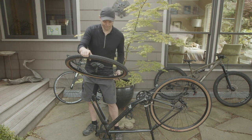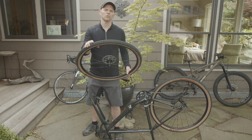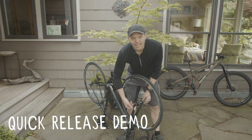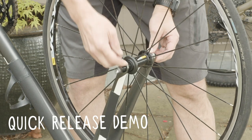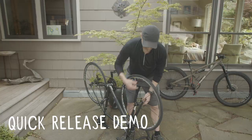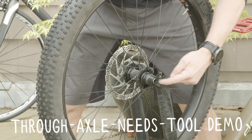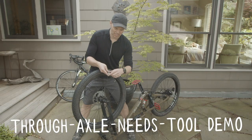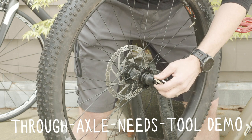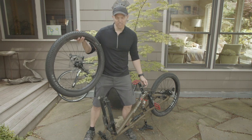That's getting flat already from just one little pinhole. I have the front wheel off. Now I want to demo the other types of attachments. Here's the quick release — that lever just needs to be flipped up, and the nut on the other side needs to be held while you spin it loose. This is also a through axle bike, and the through axle is here but there's no lever on it, so I'm going to have to use an actual Allen key. Spin that, remove the axle, and that wheel is also just sitting in its dropouts and can be lifted out.